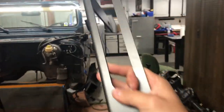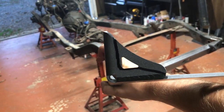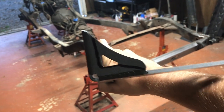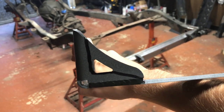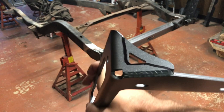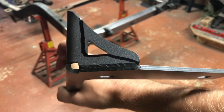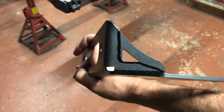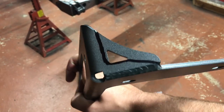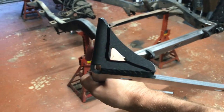I have an idea. Here's the plan: I marked it with a Sharpie, so I'm going to take my cutoff wheel and cut on my Sharpie line to hopefully clearance it enough to allow the winch to come forward. I'm going to do that on both sides. Probably should have test-fit everything before painting this. But again, that's my life — our channel isn't called Altered Life for nothing, because I have to alter everything I want to do. Let's get to altering this.